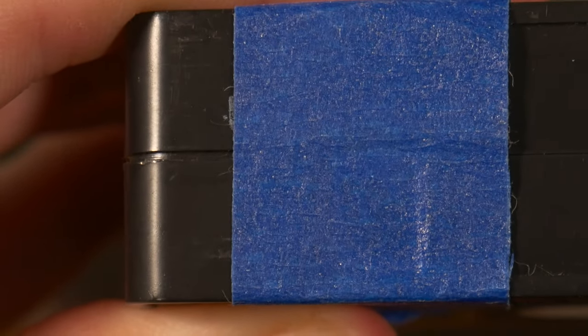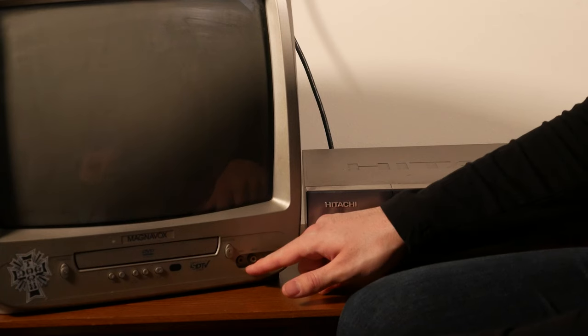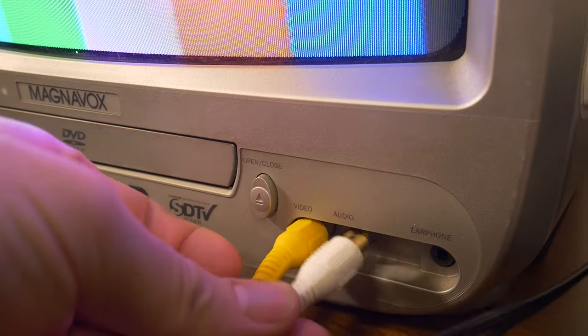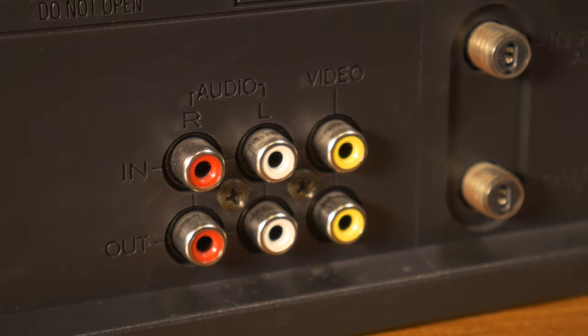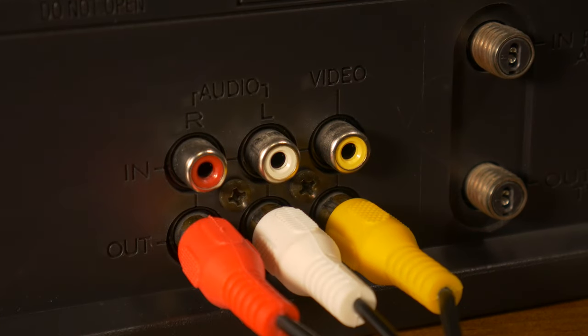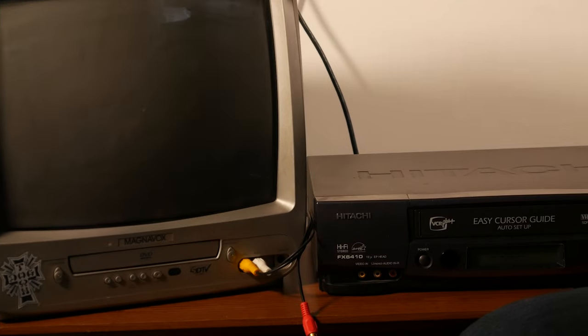Now that your tape is set up, we are now ready to move on. Follow me over here. Now depending on your television set, you'll have yellow, white, and red input ports on the back or the front of your television. In this case, my TV only supplies the yellow and the white. But if your TV supplies all three colors, make sure you plug them in for full stereo effect. Now we are going to wire the VCR into the TV. On the front or back of your VCR player, you will find three AV ports labeled OUT or IN. We are going to plug the other end of this cable into the OUT ports. Now that that's done, it's on to step two. We now have the VCR set up with the TV so now it can play.